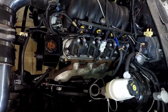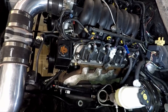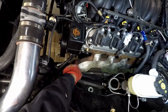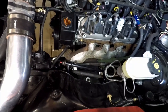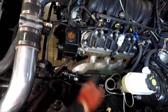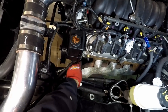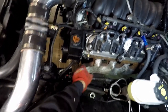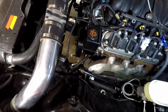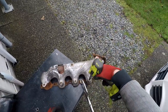Alternator's out now. It's not bolted up, but it's getting close - definitely getting close. Yeah, this section's gonna have to be straightened out, actually. It'll straighten out and tuck closer to the block, but that looks pretty promising. So hacking this up here - instead of just hacking off the flange and extending it straight down - might be the way to go. I can even put a little bend down to go underneath my power steering pressure line, but that's not bad.